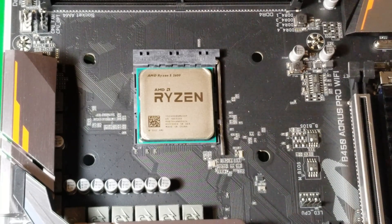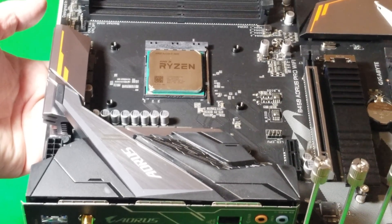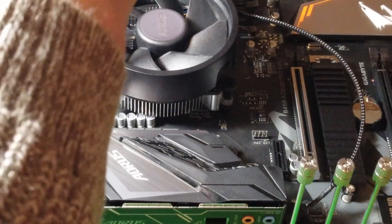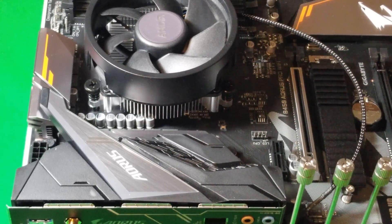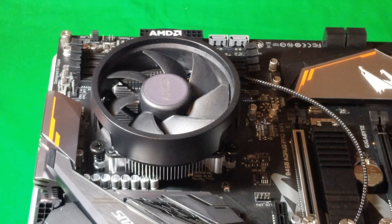You'll see your four little posts where you're going to put your screws into — they pop down. Now sometimes there's an adhesive on this that holds it to the motherboard, and sometimes not. Being on a test bench, all I do is reach my hand underneath and lift it back up. While I hold it, I'm going to align this with those four screws. If I let go it would fall back down, so first I'm going to secure it to the board. One side is always going to be a little bit more off than the others — just bring it up. All I'm doing is tightening the screws, putting my hand underneath to hold that up, same as if it were on the back plate of your motherboard.